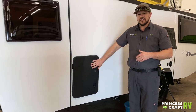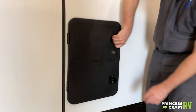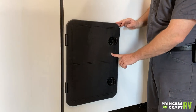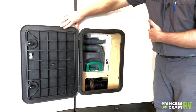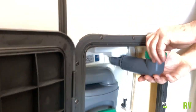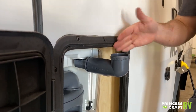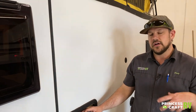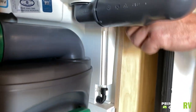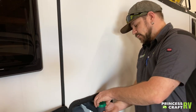Moving back, we've got access to our cassette toilet. Pull these two little levers out, rotate these knobs — 90 or 180 degrees — and if it's locked, unlock it with the key inside. To fill it up, remove this cap and put your water hose in here. Don't put it on full blast because these fill slowly. Watch your level gauge — this sight tube will fill up and tell you when it's full and when you need to add water. Once full, put your cap back on.